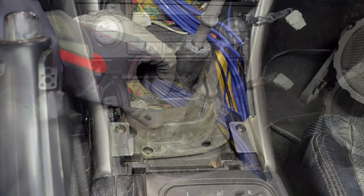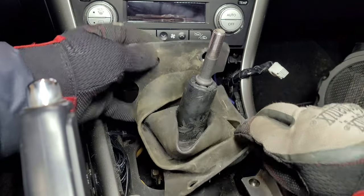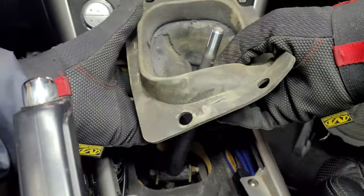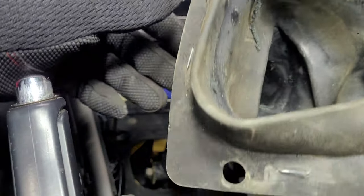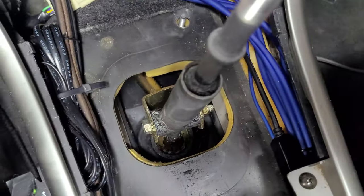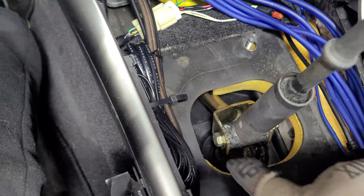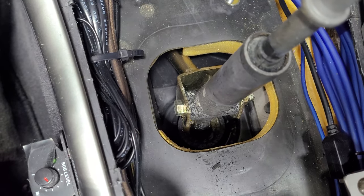So sacrifice staples. I removed all the staples and now we can get our first look at the gear linkage — and that's what it looks like. If I just keep pulling here, this should come on out, and that came off without any issues. There's the linkage in there. So essentially our short shifter is going to sit in there just like that, but we have to remove these two bolts on the side. Make sure you keep this bolt that joins the linkage there.